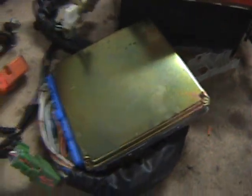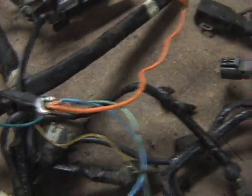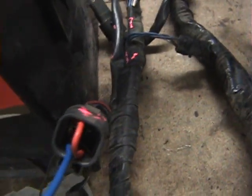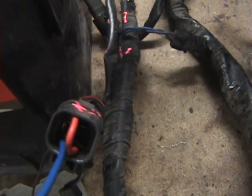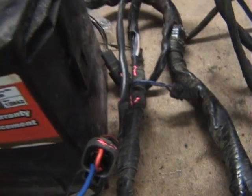Over here's another M30 ECU. As you can see the power's on — I have it hooked up here. I have a single ground wire going to all the ground areas on the harness, and the blue wire I have for power, it's powering in there, and then inside there I have a wire jumpering the coil and also the injectors, just for the test. And here's the stock dash connectors — let's see how this works.